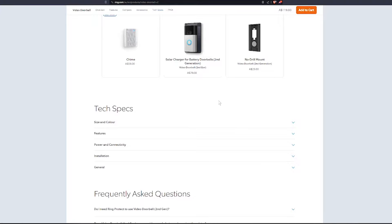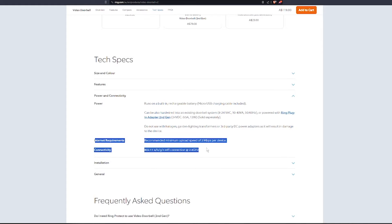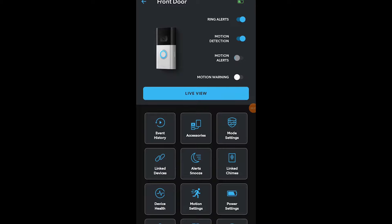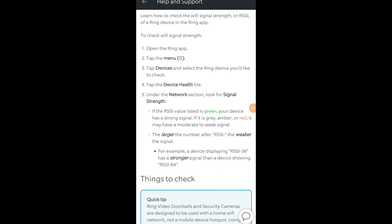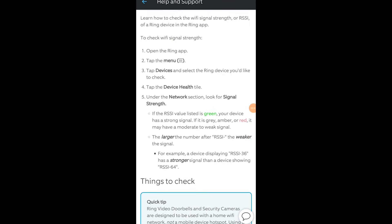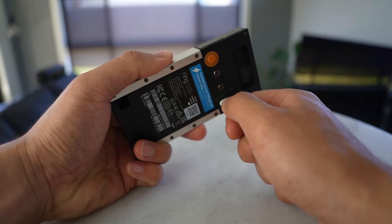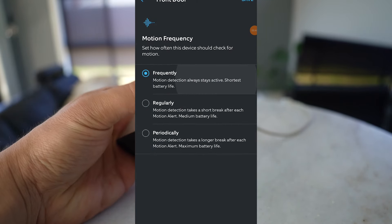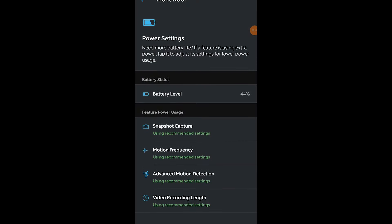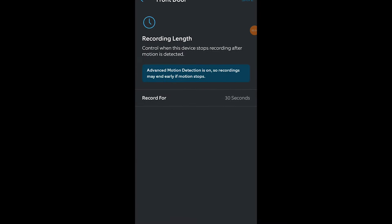Through research I've noticed some common issues to consider before buying. First, Wi-Fi: the doorbell connects to your home Wi-Fi, so in larger houses with excessive steel and concrete, ensure you're using Wi-Fi extenders or a modem with strong signal strength. To test this before buying, check your phone's Wi-Fi signal at the intended installation location and remember to switch to the 2.4 GHz band. Second, battery: for those not hardwiring, play around with the battery settings in the app — you can adjust how often the device takes a snapshot, the time between motion alerts, and how long video records when motion is detected.